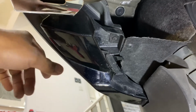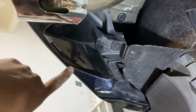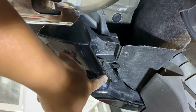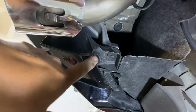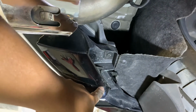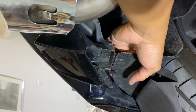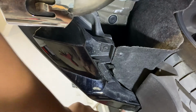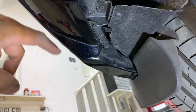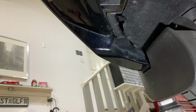These side spats are a little tricky, I think, from this installation, because you have to drill one over here, one over here, one over here and one over here. You could easily reach this opening here to put the bolt, but on this one you can't really, because that's enclosed back here. And it looks like similarly to the rest of the bolts that taps into this end. The only way really is to undo and remove this part of the diffuser.